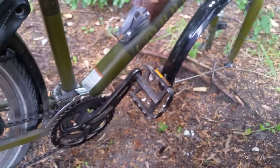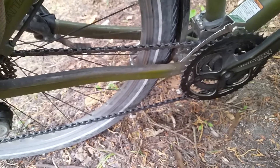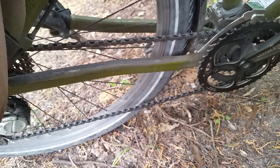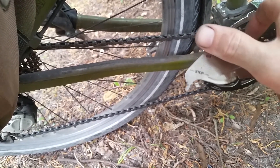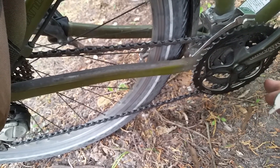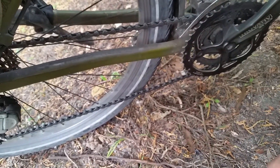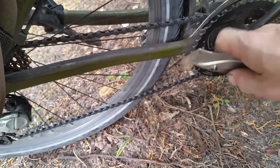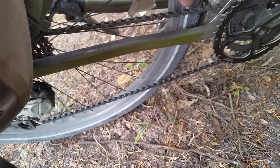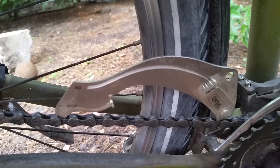Now on 11-speed chains versus 9-speed. I saw some comments and read that 11-speed chains are built a bit tighter — from the start each link is a bit shorter compared to 7 to 10 speed chains. I bought this 11-speed chain — it's the cheapest KMC — put it on, it's already 2000 km old, and still it shows nowhere on the Cyclus chain checker.